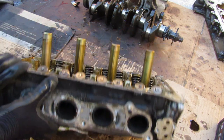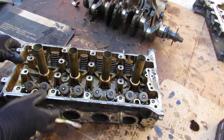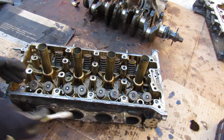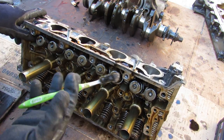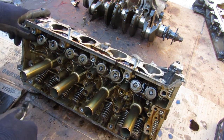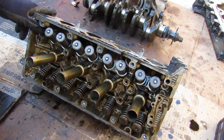There are so many different heads you can get for a K-series motor. The most common upgrade is to swap a K20 head onto a K24 block, because that's going to give you taller cam profiles, stiffer springs, and better intake and exhaust flow — so it's definitely worth the upgrade. Because parts are so easily available and easily swappable, everything is compatible with each other — it just bolts right up. That's what makes the K-series so good for tuners and people who like to modify and tinker with their cars.